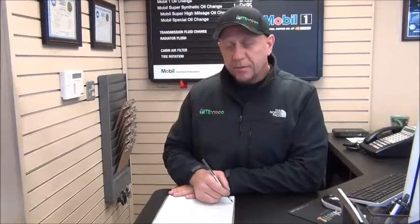That's how the process works. Now that we've completed the process, we've determined that the oil pan was leaking oil and also the rear valve cover was leaking oil. The recommended repairs in this case are going to be the oil pan gasket and the valve cover gaskets. There were some other areas we thought might have been leaking, but that's why we do this test — to make sure we're pinpointing the leak and putting the money towards the actual leak. The next part is to write up an estimate for the oil pan gasket replacement and the valve cover gasket replacement, and then move forward.